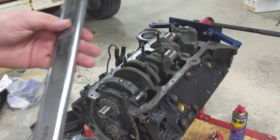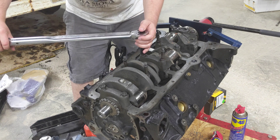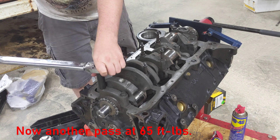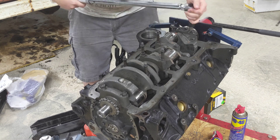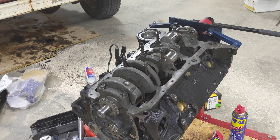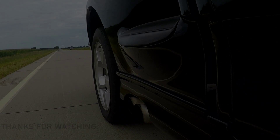I've got my torque wrench set to 40 foot-pounds. I'm gonna torque these down starting from the middle and working my way out. Now I'll turn it up to 65 foot-pounds for the final pass. And now that thing spins — two fingers on the sprocket — that's nice. Good deal.